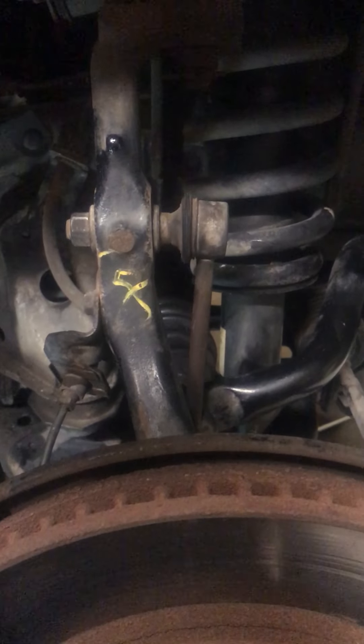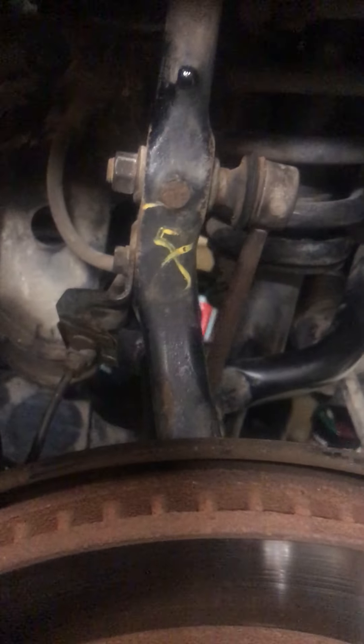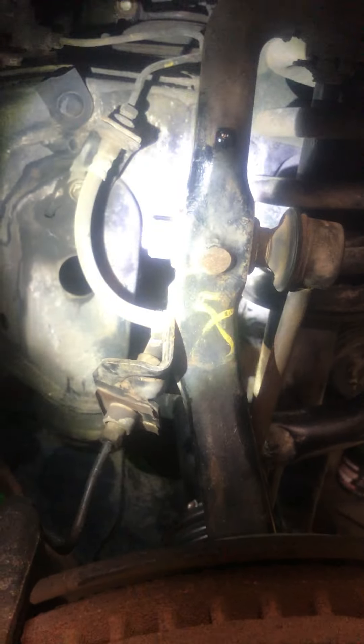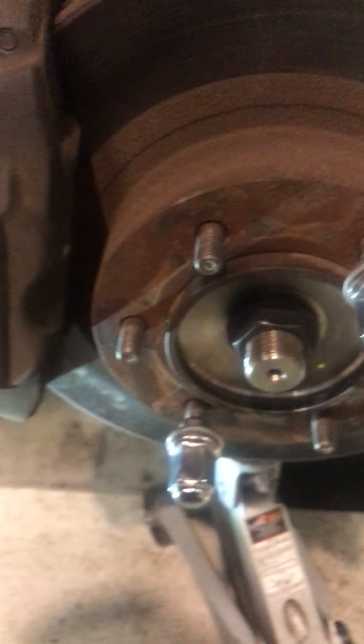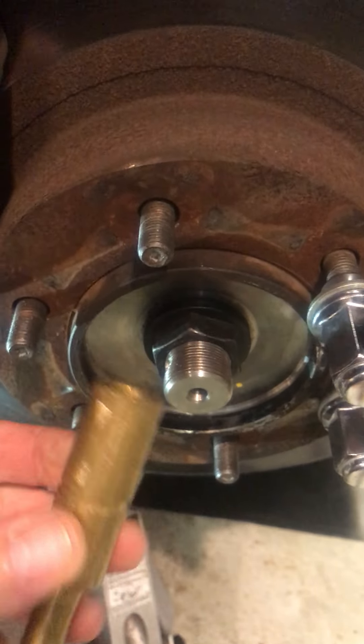That's where the fun begins. I changed the seal at the back and we'd already drained all the oil, but I found I couldn't get that snap ring — the locking ring — in at the back. It was a real challenge to get in there to that drive shaft spline. I was hammering the end with a brass drift and all kinds of things, and I just could not get that snap ring to go in at the back.